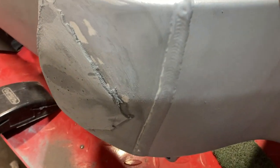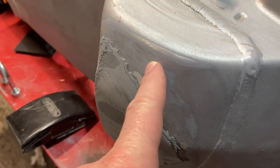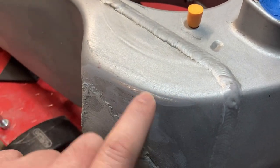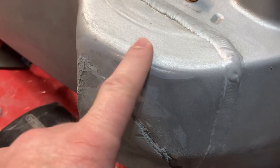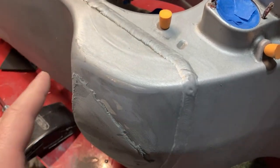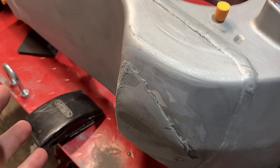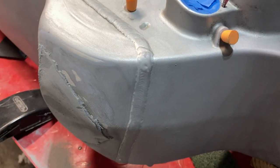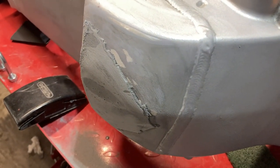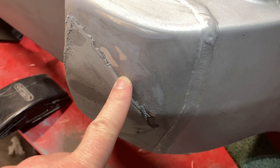If there's anyone who does body work professionally, feel free to comment below. This is aluminum — that's the fuel tank. For those of you who are not familiar with Buells, that is hollow and very thin aluminum. The bins do add some rigidity to it, but when this is full of fuel and you've got a hot engine, there's a temperature differential. It goes through some pretty rapid changes whenever you fill it up with cold fuel — the outer side is going to cool off much faster than the inner bit of the frame fuel cell. So I have to be careful with what I use. My notion is that I'm going to use a minimal amount of fiberglass body filler — fiberglass Bondo.